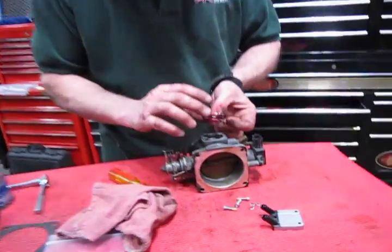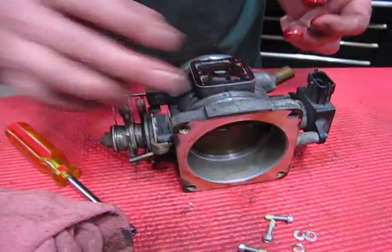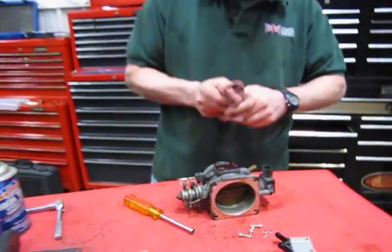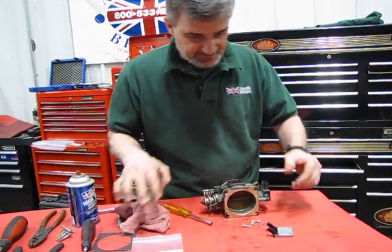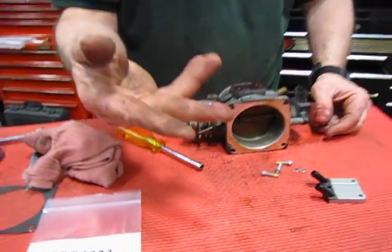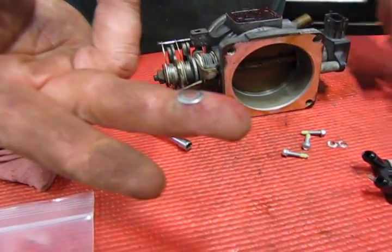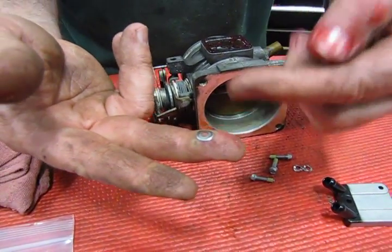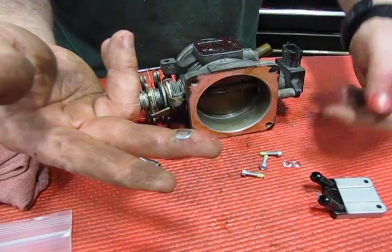And we'll just set that right on top, and we'll let that get tacky for a few minutes before we put the plate back on. And that's basically all that's going to really do, is we're going to put the screws back on. Now what I want to mention is, and you're going to notice, these aren't like a conventional lock washer. These are basically a spring washer. In other words, they arch, and when you tighten the screw down, the arch of the spring actually holds tension on it to keep them from coming out.